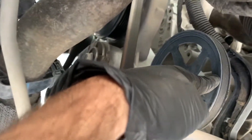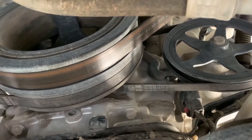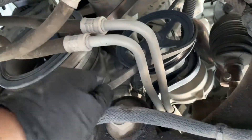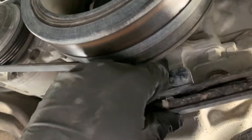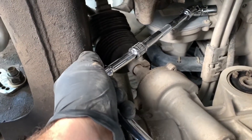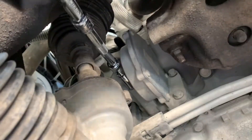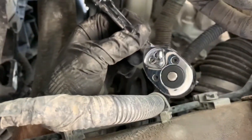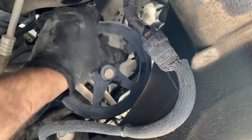This is the actual part that we are going to take off from the truck. You can use a wrench to turn the engine and dismount the belt, but I'm just going to cut it. To facilitate the removal of the vacuum pump, undo these clips — there's a clip right here and another clip right here, removable with a flat head screwdriver. To actually remove the vacuum pump, use a 3/8 drive and a half-inch socket. For the last bolt, the easiest way is to go from the outside of the frame on the truck. Just be aware that there's going to be some oil dripping. The easiest way to pull the vacuum pump is to the front of the engine.